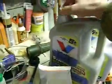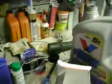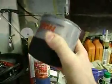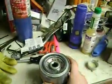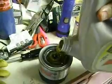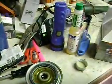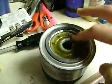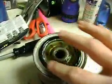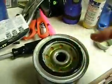So what you gotta do is take some oil, and I mean this step isn't necessary, and for some cars it's not even possible, because for mine at least, the filter sits straight up, but some cars they're like at an angle or something. But what I like to do is just fill it up with a little bit of oil, so you don't have a dry start, more or less. And this isn't absolutely necessary. Your engine's not going to die after like a couple seconds of no oil. And then take some of this new oil and rub it around on the gasket. That way it gets a good seal, and that seats in all the way.